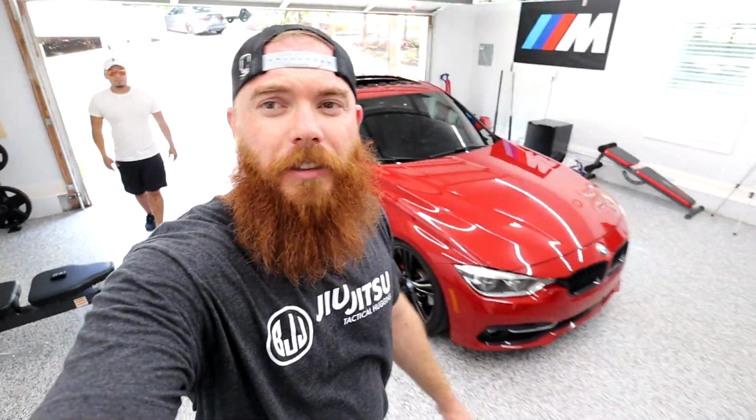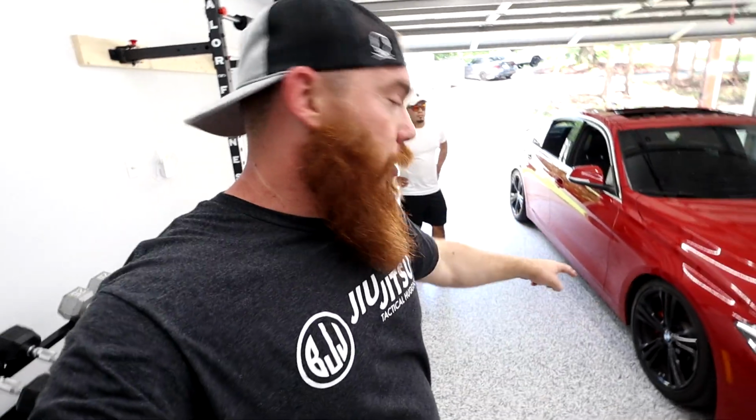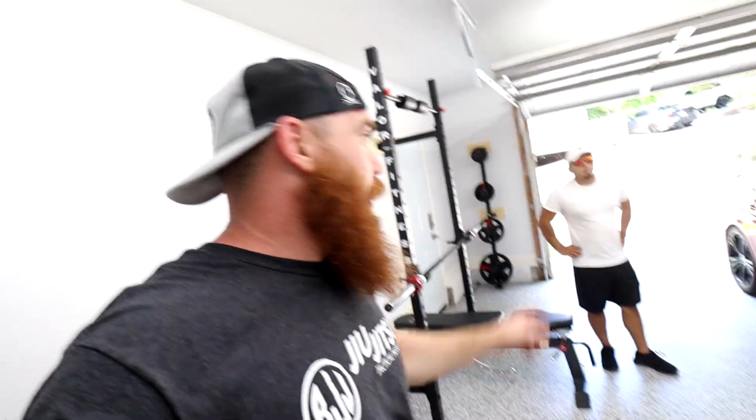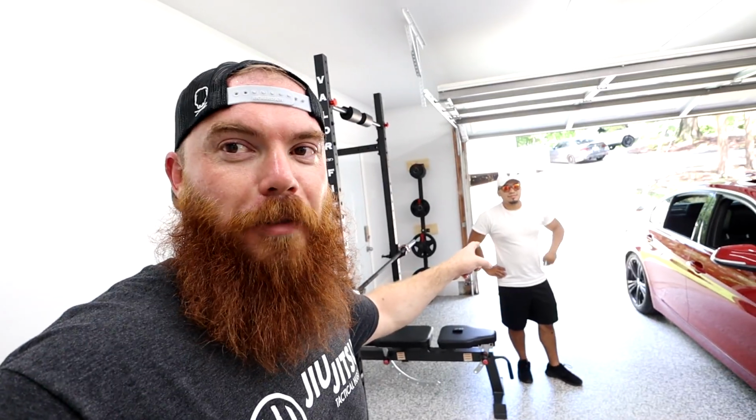I think that was the first video that we've seen on a rear-wheel drive 340, because the actual front of these cars are a little bit different on spring installation than the all-wheel drive. The all-wheel drive, you don't have to remove any parts off the actual suspension. And this one, you do have to remove the tie rod in order to get it to dip far enough for the strut to actually come out. And that was his idea, and it worked. So he knows what he's talking about.